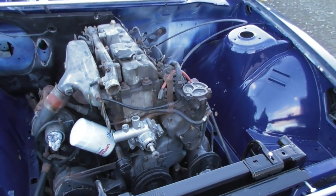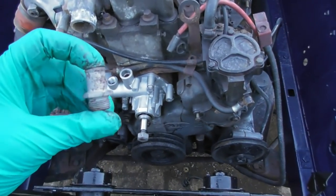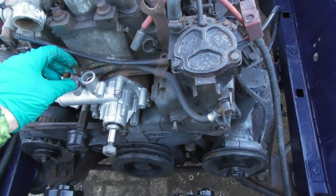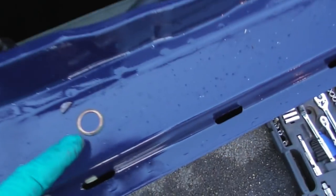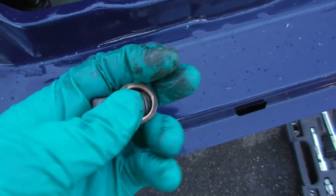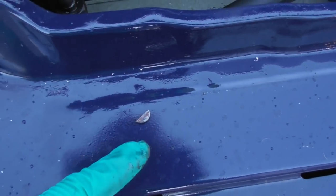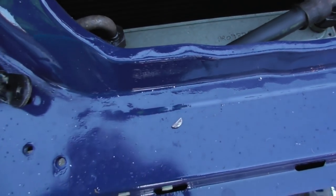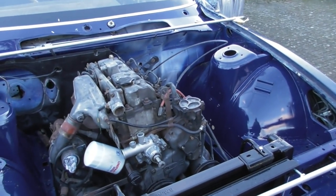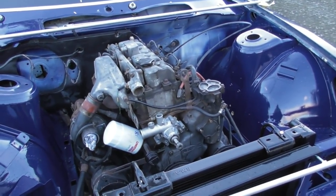The water pump is on and all nipped up. I don't have the torque values because I don't have the workshop manual to hand, so I've just nipped them up. Now it's time to reinstall some of the ancillary parts - there's the little port that goes in there, a copper washer, then a tiny little Woodruff key which goes between the shaft and the pulley, and a little rubber joiner hose that goes up to the thermostat housing. I'll root through my box of bits and work out what goes on next.